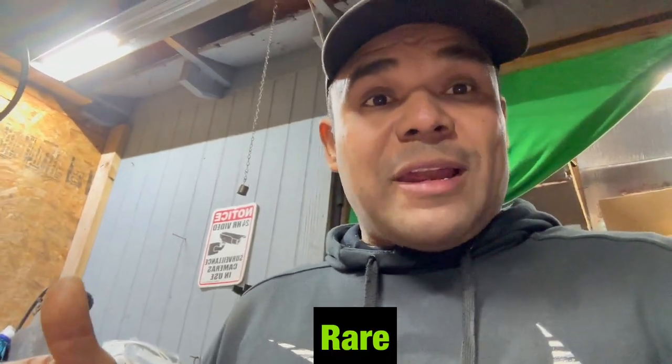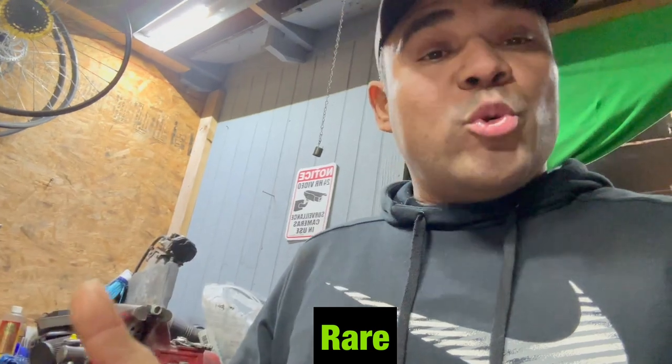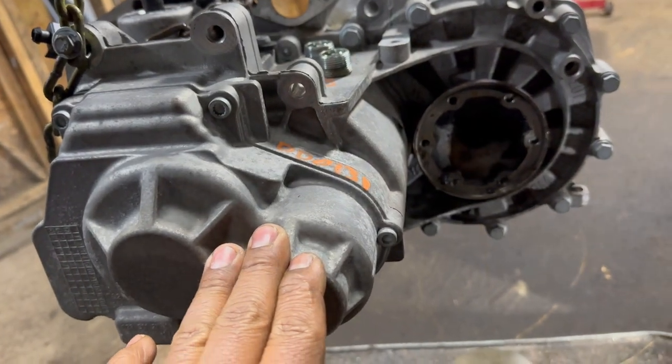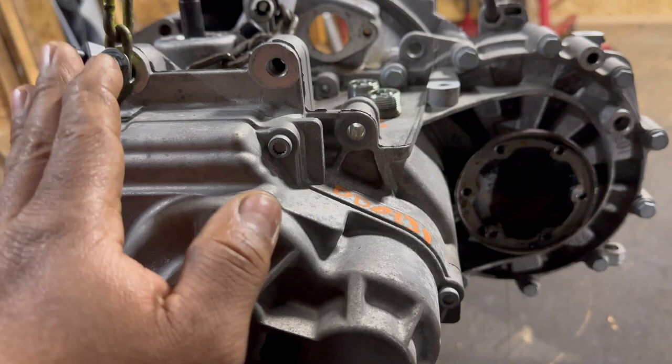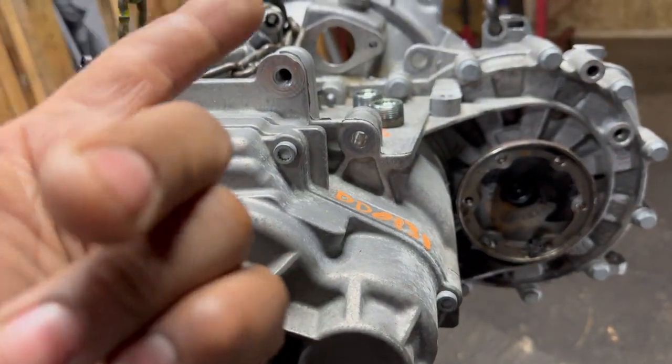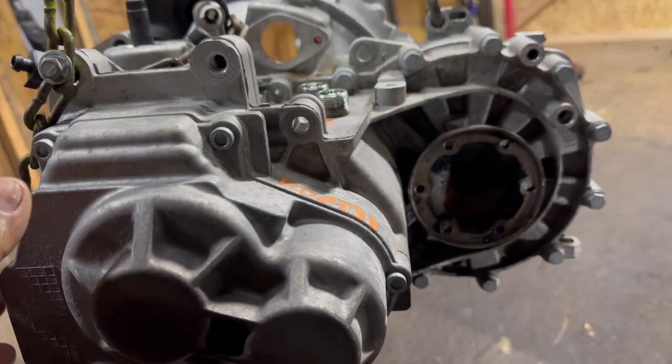That's what I'm doing right now. I got my hands on an 02S transmission, so we wanna try to put this gut into an 02J case. So I'm gonna be tearing up one of my old transmissions that I have laying around, and I don't know, we will see if this one works. The gear ratio is pretty close to what I have right now on my TDI diesel.